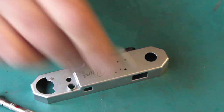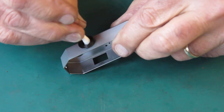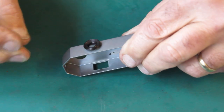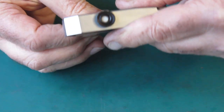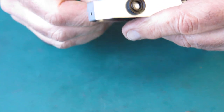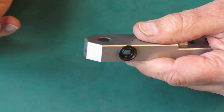That top cover is good now — that's nice and clean. I need to clean the glass in here. I'm going to clean the eyepiece on this top cover — first I'll start with the outside surface. Here I've just got some domestic glass cleaner on the cotton bud. I'm cleaning that outside surface — that's usually the dirtiest part of course, and it's the easiest to get to. Now to clean the inside surface, I'll just pass this right through from the front of the camera and swirl it around that glass surface. It does a pretty good job — even though that rectangular opening is pretty small, the tip mushrooms out and it'll sweep a bigger section of glass. That's quite clean now, I'm quite pleased with the state of that.